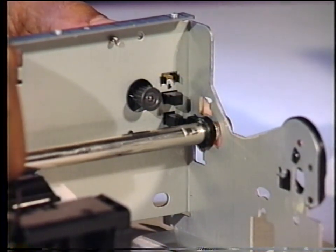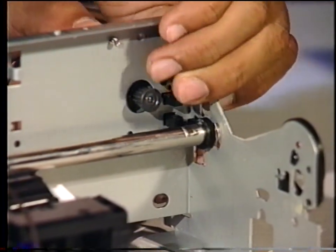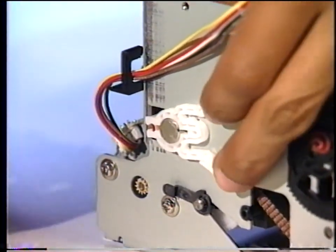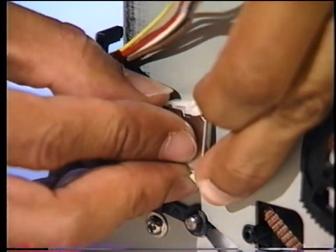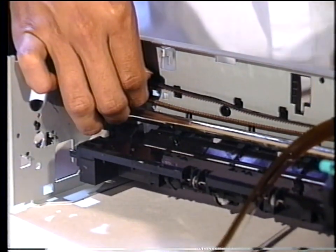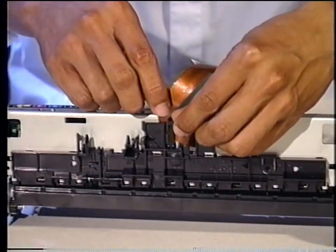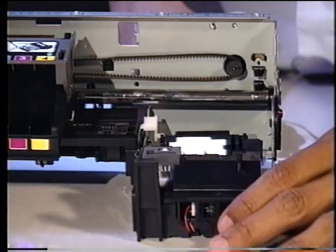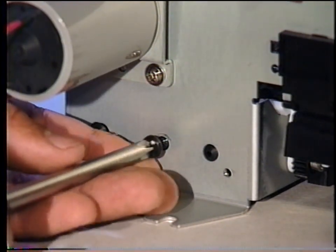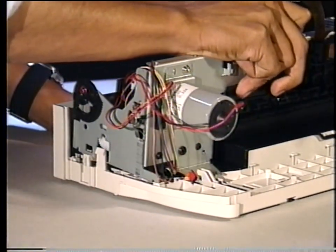Insert the carriage shaft through the printer's frame, the carriage unit, and black encoder holder. Use a new clip to secure the right side of the carriage shaft. Pinch the scale holder so it attaches to the linear encoder and carriage shaft. Then install the stopper by flexing the scale holder outward and positioning the stopper under the holder. Attach the carriage belt to the carriage motor. While pushing in on the pulley assembly, fit the belt over and onto the pulley. Adjust the belt tension and tighten the screw on the pulley assembly. Insert the carriage ribbon cable through the frame of the printer and then insert the cable into its holder on the frame. Carefully slide the purge unit back into place while lining up the guide pins to the rear frame of the printer, then install the black screw. Attach the printer's body to the bottom cover by inserting the body under these two tabs and then latching the sides of the body.